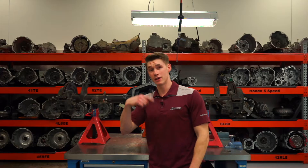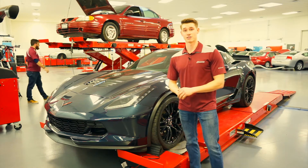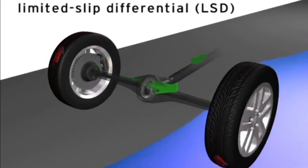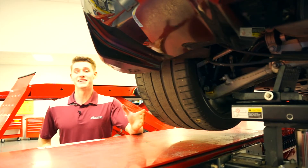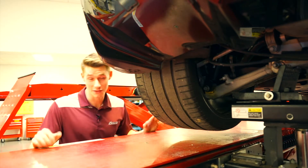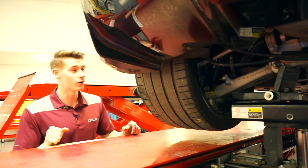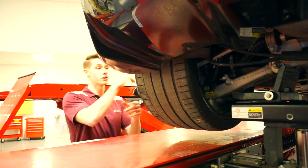You're just going to keep spinning and spinning your wheels. This is where the limited slip differential comes into play. It's exactly what it sounds like — it limits slip. So when one wheel loses traction, the limited slip differential sends torque to the wheel that has more traction. You can identify a limited slip differential, like on this Corvette Z06 provided by GM — we thank our sponsors — by simply turning the opposing drive wheel in the same direction; the opposing drive wheel should turn in that same direction.